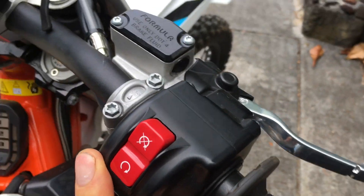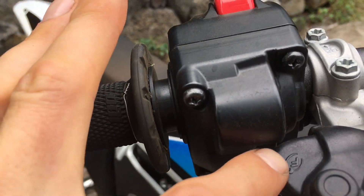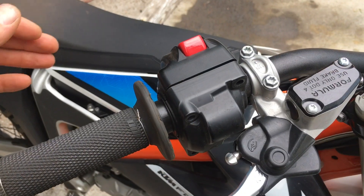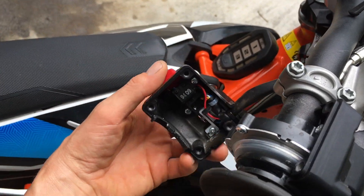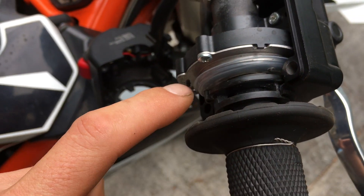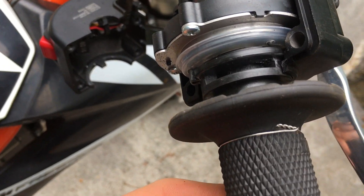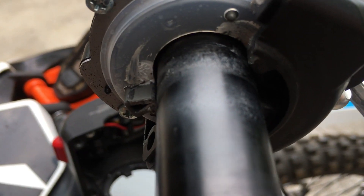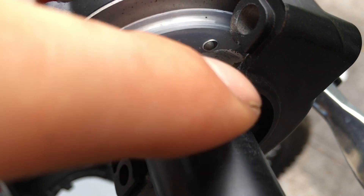The original throttle tube is extremely simple to remove. All you have is four number-two Phillips screws on the back. The front piece comes off and then the throttle tube just pops right out. I've got the four screws removed — apologies for the wind picking up — the front of the throttle unit comes off, and you can see the fly-by-wire or ride-by-wire setup right here. Just give the throttle tube a little wiggle and it pops right out.